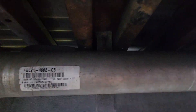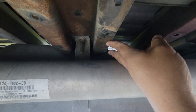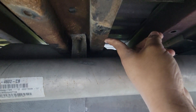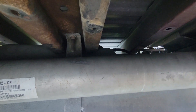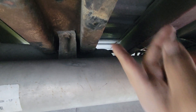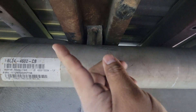Even back here I have clearance now, but if I were to hit a big enough bump this might also make contact, because I have more clearance here than I do above my c-notch on the rear of the truck — and more space from the c-notch to the axle than I do here. So I'm gonna have to notch it, cut a section of pipe and put it here, or box it like I was saying.